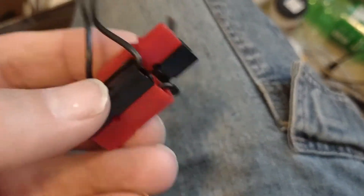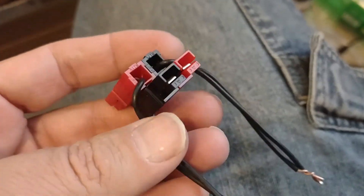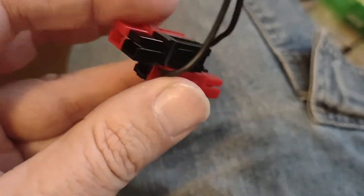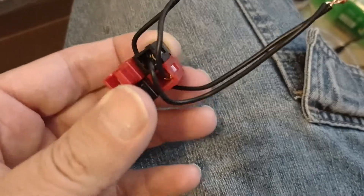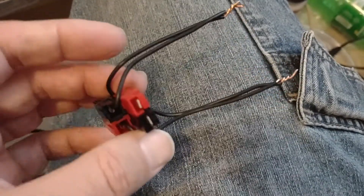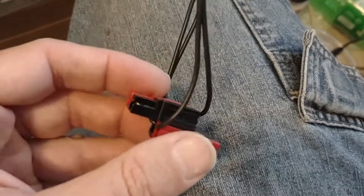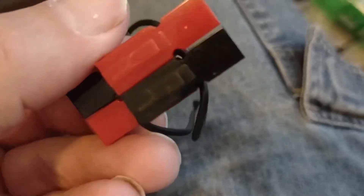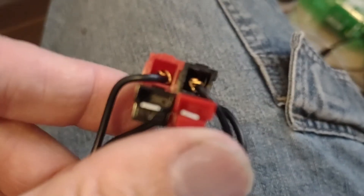Once I got the wires in on the first bike into that bag, that bag was about ready to explode. I didn't want to take it back out to rewire some lights. So I made a special plug — these are Anderson connectors. The battery comes with Anderson connectors on it, and I made a special plug that kind of plugs in between the motor controller and the battery. It's like a double plug, and then I can siphon power off of that. It took me a long time to figure out what these things were — I had to search all over the internet because they're kind of antiquated. But the battery comes with these connectors so I figured I'd keep them, because if you ever need to replace the battery it will probably come with another set. These are called Anderson connectors and I wired them up myself.